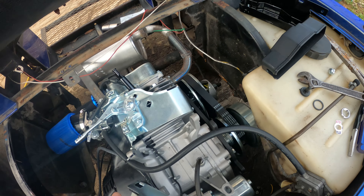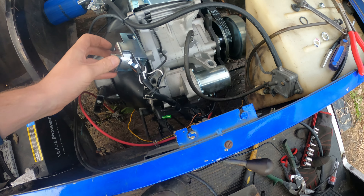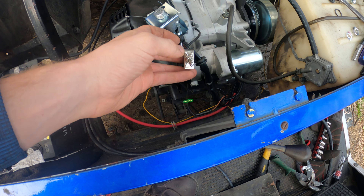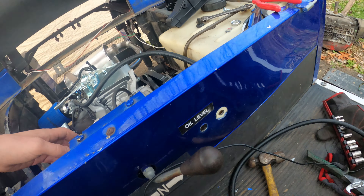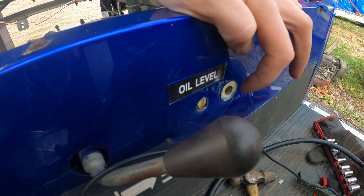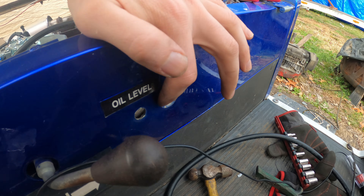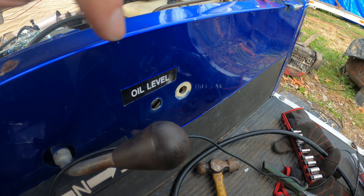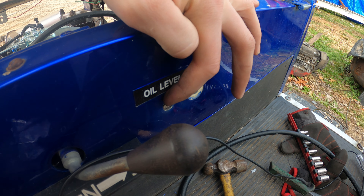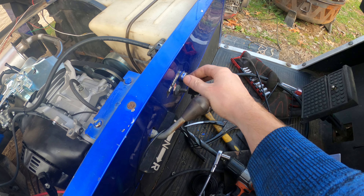I've taken the key box on the 420 all apart. This is the ignition key and this is a little switch. That was the push button one but I broke the push button, so I'll put a toggle switch on it. I'm gonna use these existing holes — drill this one out a little bigger so I can screw on the key lockdown nut. This will be the key position and this will be the on ignition. I was using the choke hole and a sensor light hole. And now I can start it without having to lift the seat up.